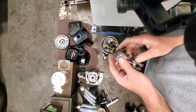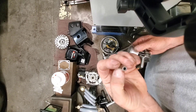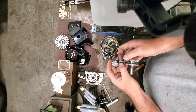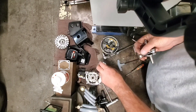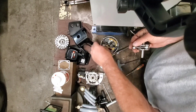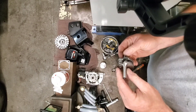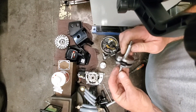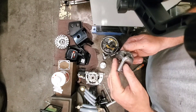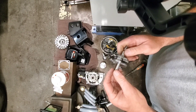Once you have that circlip out, get in there and push the piston pin out. We won't be reusing this one — this one's really heavy, and I'll show you guys a trick a good friend of mine showed me. Pull this out and there are a couple of washers alongside the crank — here's the piston and the ring. These washers help center the piston on the connecting rod — we'll keep those. There's a nice new bearing in here too — we'll keep that. So there we are, down to the crankshaft. In the next video I'll show you how to check this and make sure it's straight, then we'll do some balancing on the flywheel, get our bottom end buttoned up, and start working on the top end. Thanks for watching.